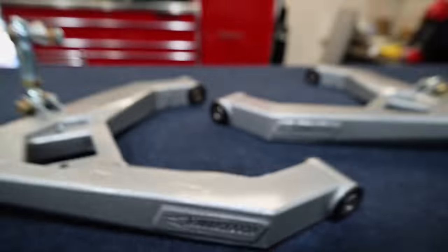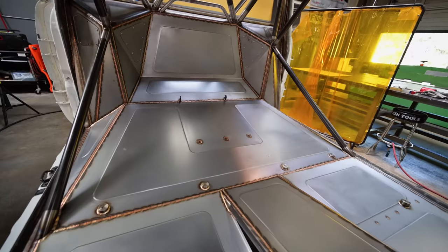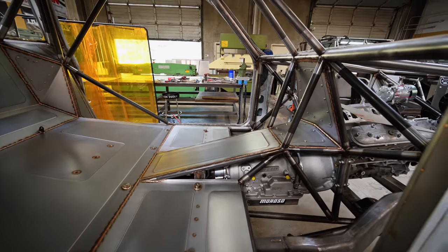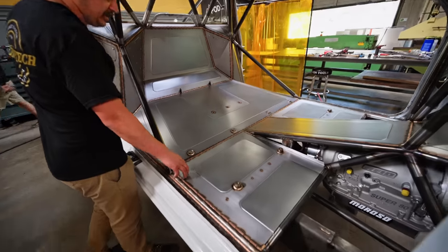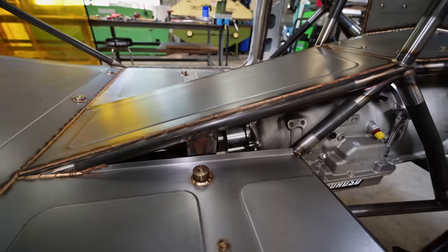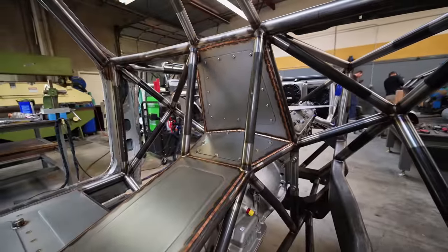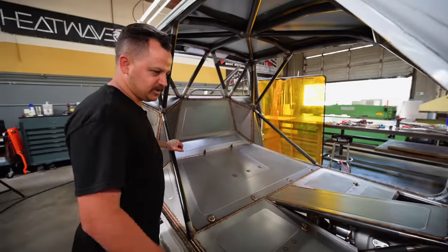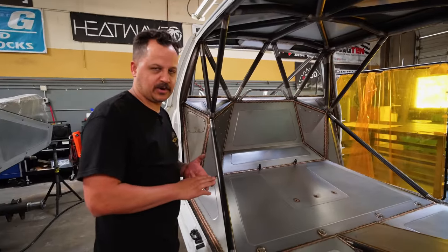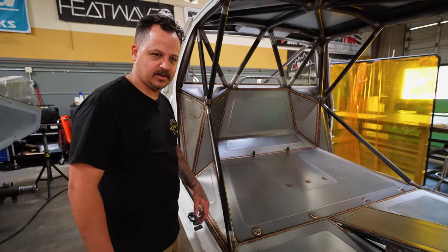We got these loaded up on our website. Back over here on Dan's truck — all the sheet metal that is done so far is 100% welded in. Seat mount bungs are in, panels came out really nice. Chase spent a bunch of time on this thing. The center piece and the firewall are done, two access panels are done. So now that this is done we're going to jump to the front suspension, get all the steering and ram assist, A-arms, spindles and upper arms back in place, and then start placing the front shock mounts and bump stop mounts.